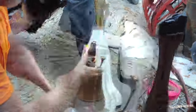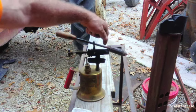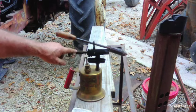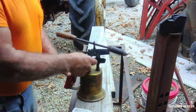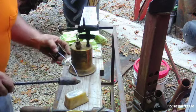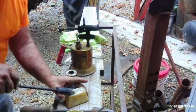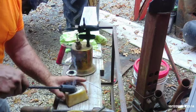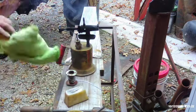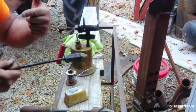It's getting close. If we were inside the shed where it's a little bit shaded, you could see the blue flame. It should be blowing out about so far. This torch hasn't been used in so long it probably needs a little maintenance — leaking a little pressure here and there. So it's going to take a little while to get my soldering iron heated up. We're generating enough heat now. I'll take a little solder and the sal ammoniac block to my iron.